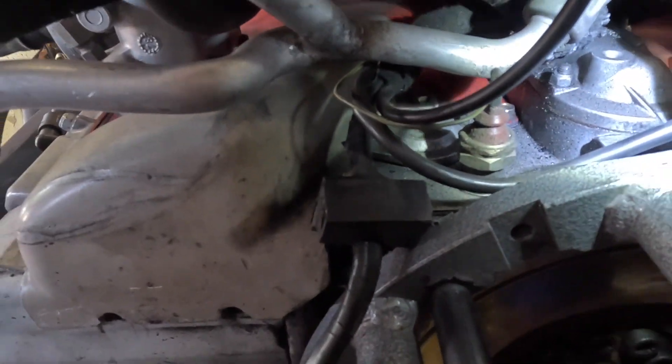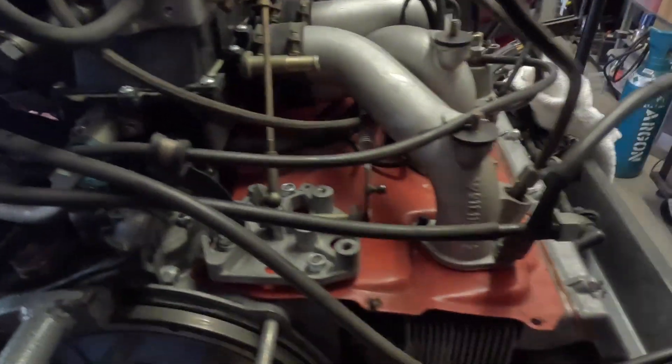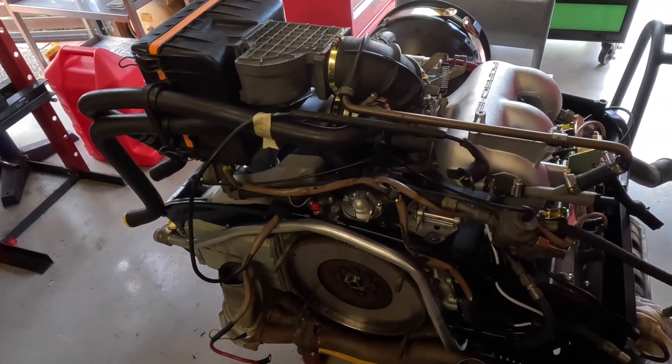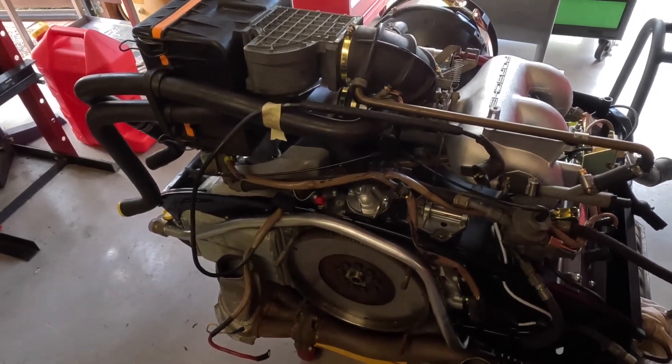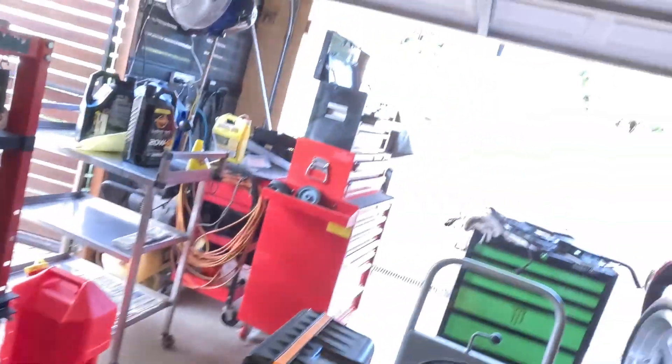This one actually wasn't rebuilt by me but it was done pretty well. I'm just noticing some sweating down there - it looks to me like the gasket for the breather cover is failing. So the engine breather cover just here, the gasket looks like it's failing. Apart from that, everything's in good condition. I'm not sure - I'm actually contemplating putting this in my car, just for somewhere to put it. Worst case I'll store it underneath the car to give myself some space to work. I'll pick this up on the next video, thanks for watching.